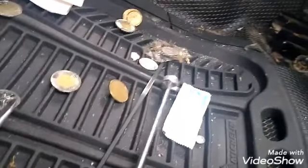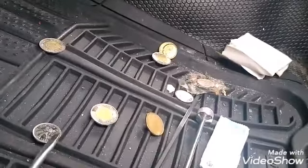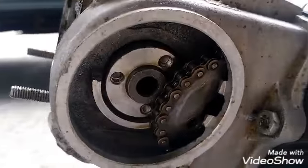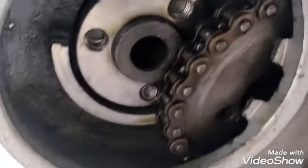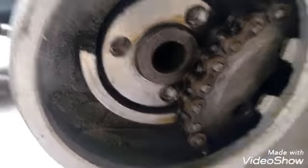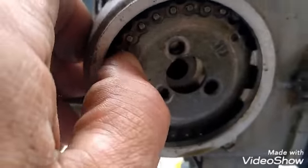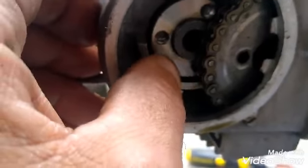Just killing some time waiting for some customers. Well, I figured the problem out here. As you can see, that circle there is snapped — that piece on top — there's actually bolts that broke off inside, you can see them. I found one right here, and it snapped off. So that could be why it's not getting compression. The bolts were snapped off and this was just hanging there.